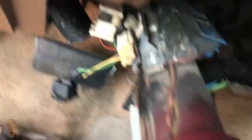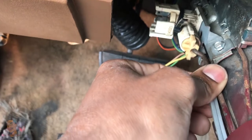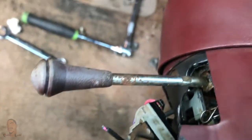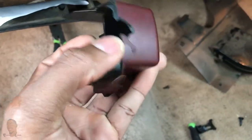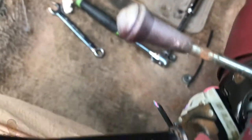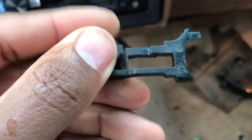What that bracket looks like. Normally this little rod would be inside the dimmer switch — all you'll have to do is just pull it. Mine is broken because I tore up this damn housing when I couldn't figure out why my lights were messed up. I tore all this up thinking that it was this — why my lights wouldn't come on. And it turns out it was just a dimmer switch. I had to go to the junkyard to pull this small little piece right here because I broke the one that was in my steering column. But let me get back to this video.